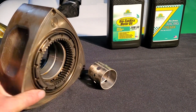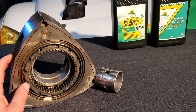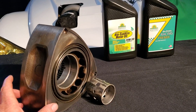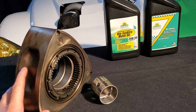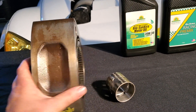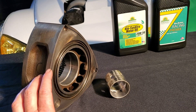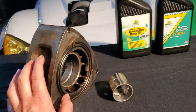Here we have the center rotor out of my competition motor. The big thing I like to look at is that it's really not carboned up. We do run a lot of water injection on top of the ethanol and nitrous. I see a little bit of rust in here, but more importantly we're not getting carbon buildup — basically zero carbon buildup. That's a big thing I always look at. Depending on what pre-mixes and fuels are being used, you can cut down the lifespan of a rotary dramatically if any of those combinations are causing gumming or carbon buildup.